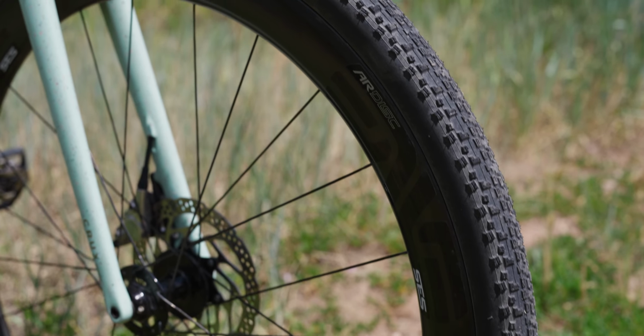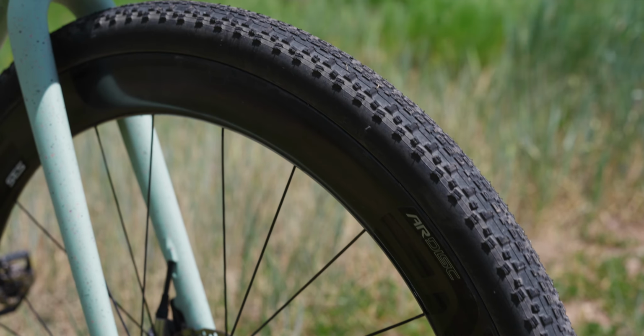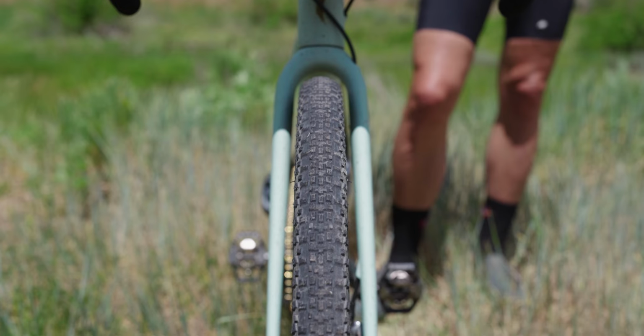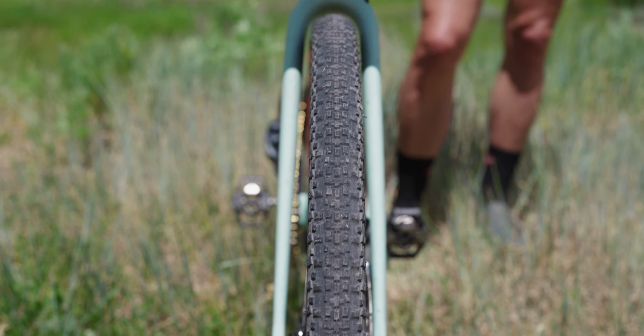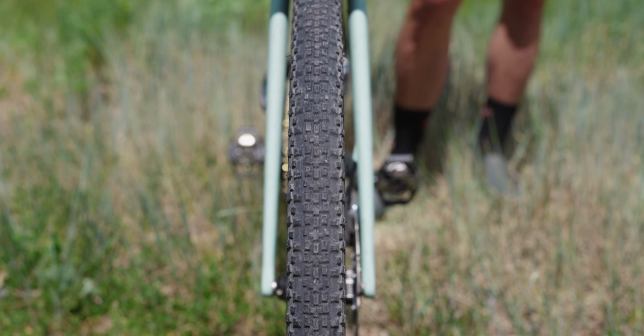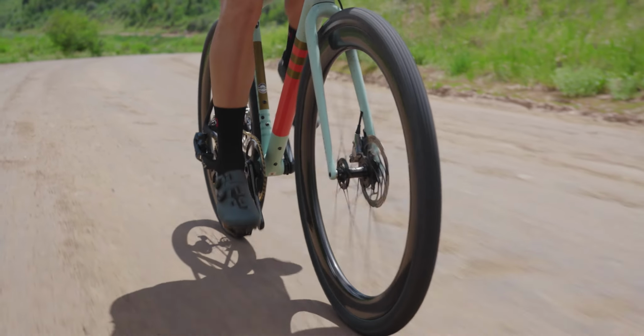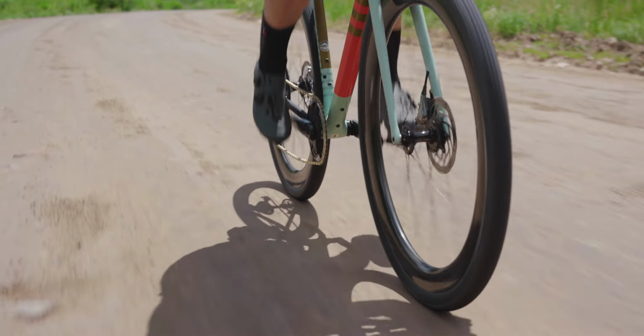And let's not gloss over that. Puncture resistance is everything with tubeless gravel tires. Plugs are great, but not for sidewall tears. And getting a tubeless tire seated in the middle of a race with an emergency inner tube can be a nightmare. As an aside, the tread pattern on the Rambler is very reminiscent of the old Maxxis Crossmark, which is one of my favorite all-time mountain bike tires. And if you look closely, you can see the DNA of that high-performing tread pattern in the Rambler.